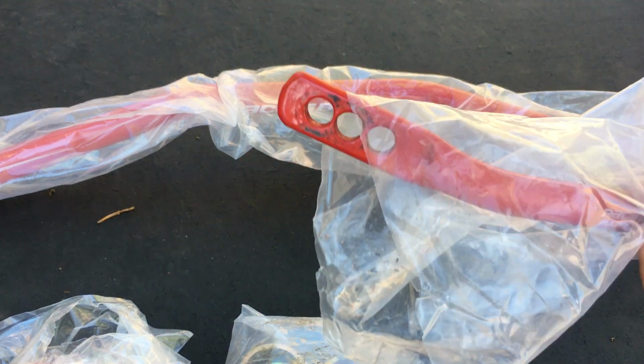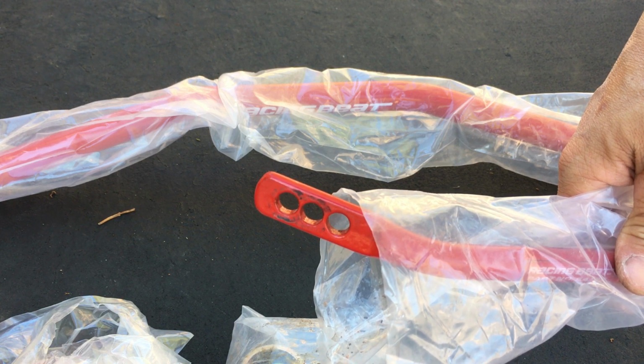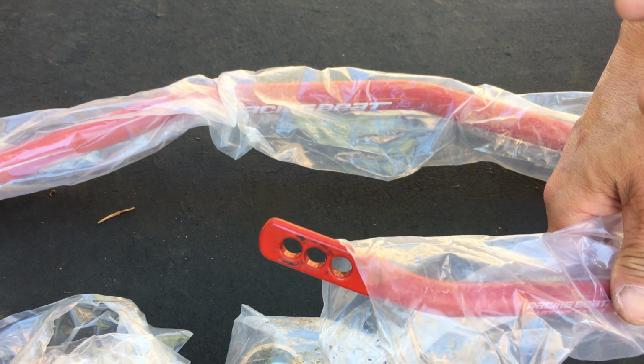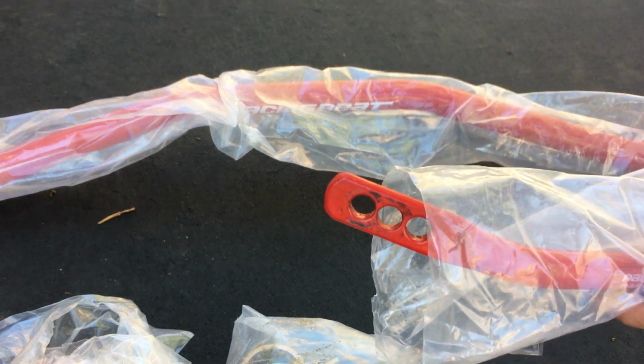As far as how they feel, really good. They're very sporty. They keep the car very flat. There are three holes for adjustments, three holes on both the front and the rear. Initially I used the middle holes for the front and rear, and I didn't quite like it. I thought it was a little bit too stiff, too flat. It didn't feel like I was driving a Miata. It felt like a more sporty, high performance car. I didn't want that. I wanted the flexiness and the softness of a Miata. So I switched it to the softer setting, and it felt really good.